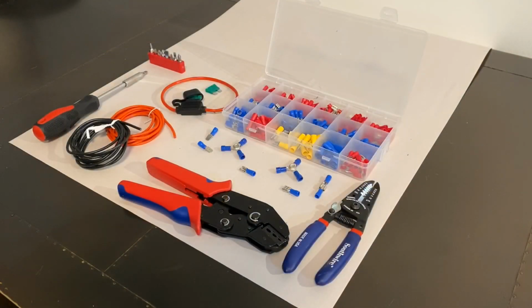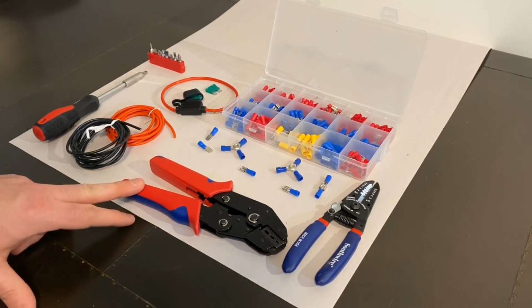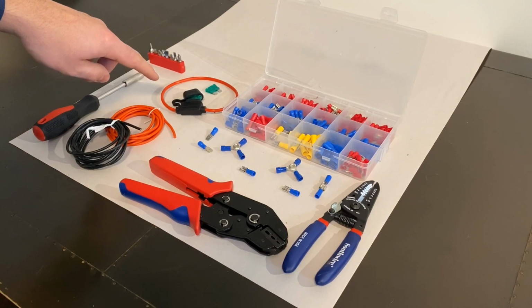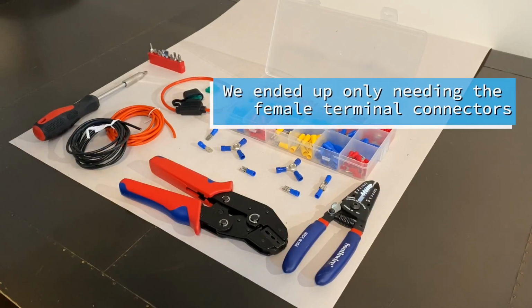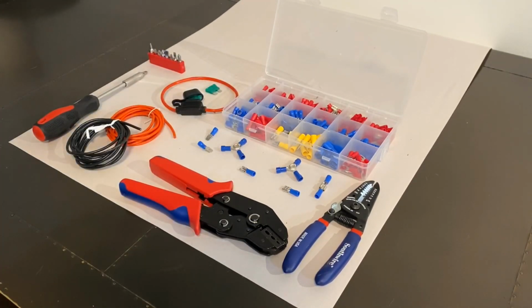Other equipment needed to complete the conversion include a screwdriver, a wire stripping tool, a wire crimping tool, 4 feet of 16 gauge electrical wire, and a 12 gauge inline fuse with a spare 30 amp fuse. We'll also need an assortment of male and female terminal connectors and 2 three-way connectors for a 16 gauge wire. And I'll provide a list of all the materials needed in the description of this video.